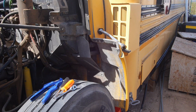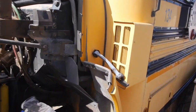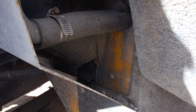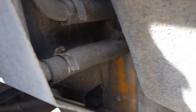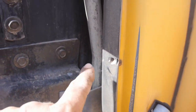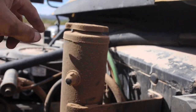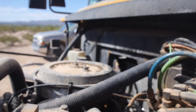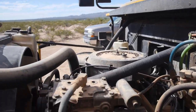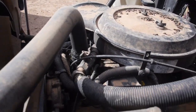Yesterday I showed where two hoses come out right down here. So these are the two hoses that come out from the heater core we just removed. There's that one and one above it. They've got little chunks of flex hose, and then they go rigid tubing, steel pipe probably, and then they go back to flex hoses. One goes all the way across. I think this was set up so they could have a second heater core, and possibly for a Texas bus they didn't include it. But that hose then goes down to the radiator on the other side, and this hose comes down to probably off the water pump.